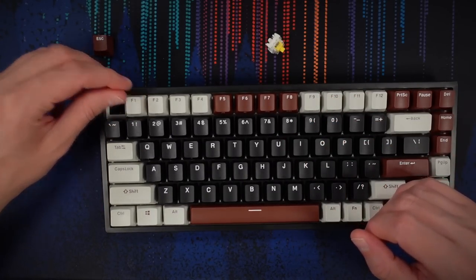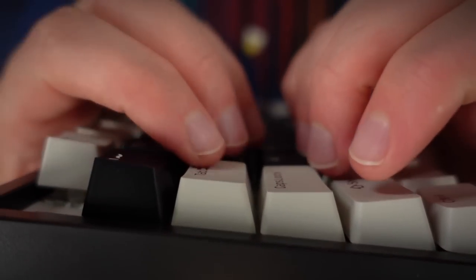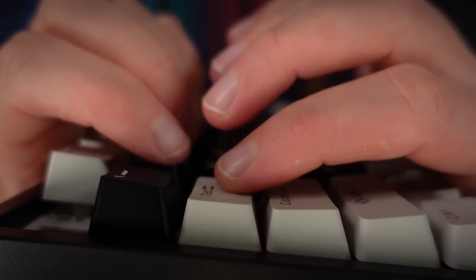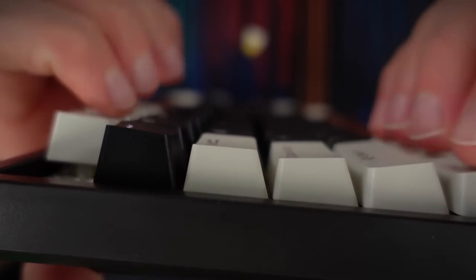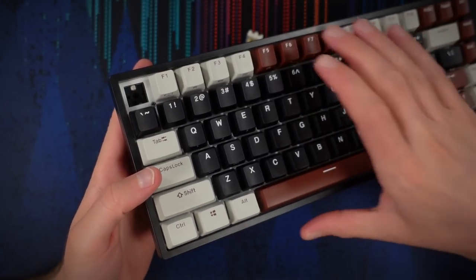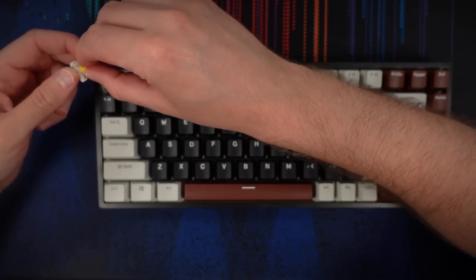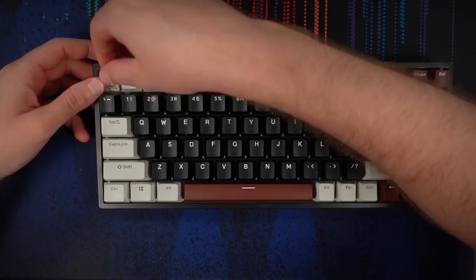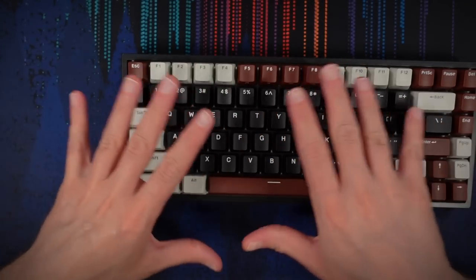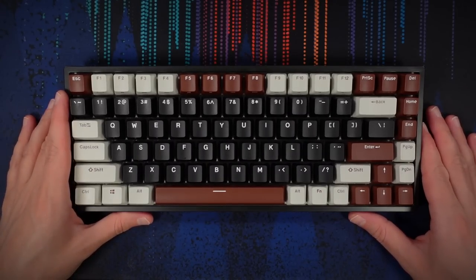So that's pretty straightforward. The keycaps for their part, I didn't point this out, but they are standard OEM profile, which is the profile you are probably most familiar with, that everyone knows and loves. It's a kind of straight edged profile with gently scooped tops and this tiered kind of rows. Pretty straightforward, a pretty typical layout, but it looks nice and sharp. Overall, the effect is one of a very clean board. The keycaps, of course, are not shine through, so the light that comes through the switches will mostly just diffuse out around the board between the switches rather than shining through the keycaps. So, what else must we look at here?